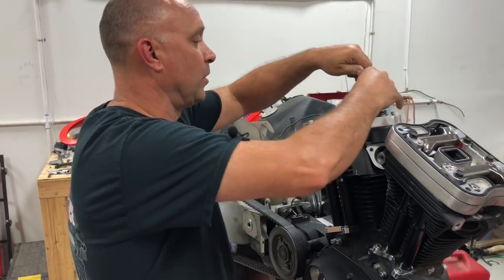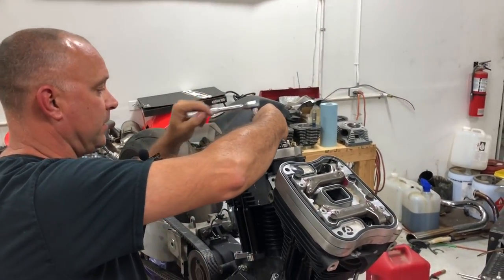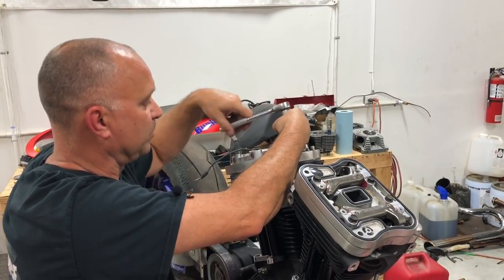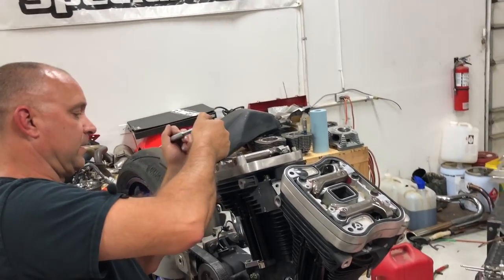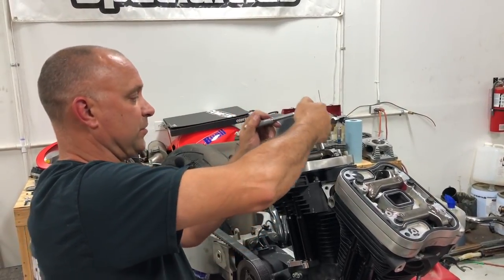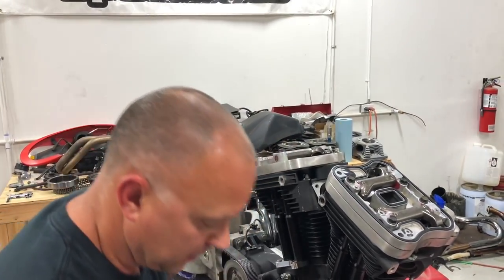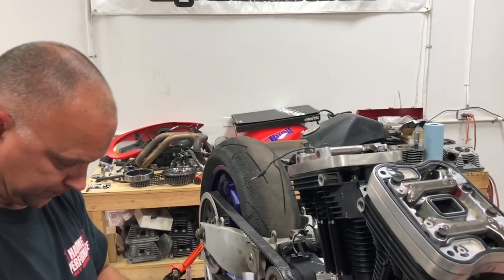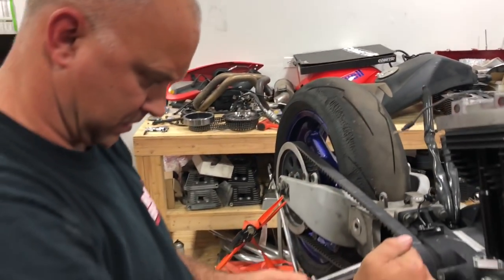At that point in time, you can start putting on the throttle body or manifold and carburetor, exhaust, all those things. By the time you're done with that, the lifters should have had plenty of time to bleed down on the other assembly. This makes it so nice not to have to put this rocker box assembly on with it lofted way up in the air, if you're sitting at a certain point on the cam lobe, and take a chance of breaking bolts and whatnot. So again, 200 inch pounds for me on the top.